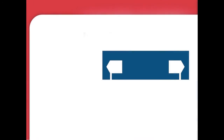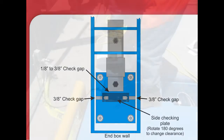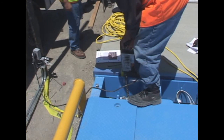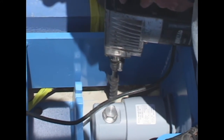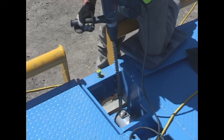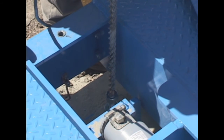Note that the side checking plates measure three quarters of an inch on one side and one half of an inch on the other. Flip it one way or the other so that the clearance between the side checking plate and the end of the way bar is at least one eighth of an inch and no more than three eighths of an inch. Now drill and install the anchor bolts using the four corner holes in the base plates as drill guides. Be sure the base plates do not move during drilling. You can drive in the anchor bolts using the hammer drill with the hammer function only. Tighten the nuts on the anchor bolts to 300 foot-pounds or to the manufacturer's recommendations.